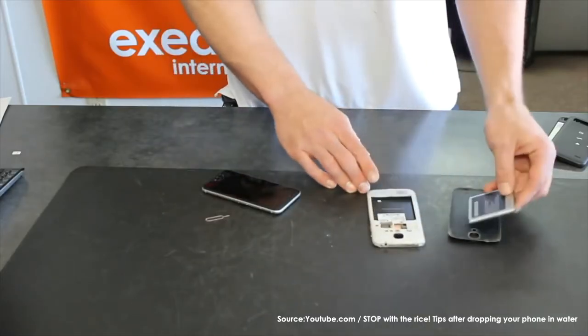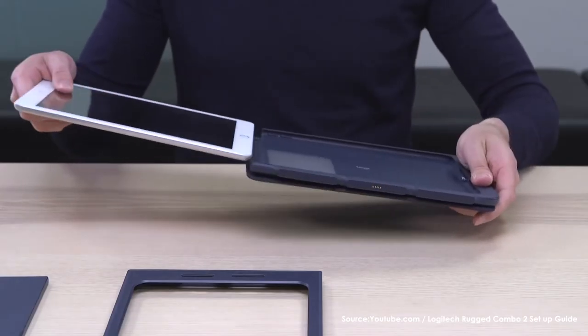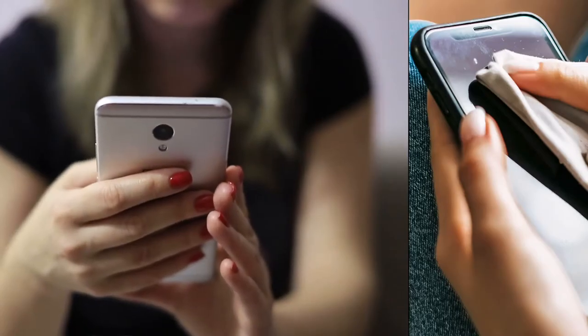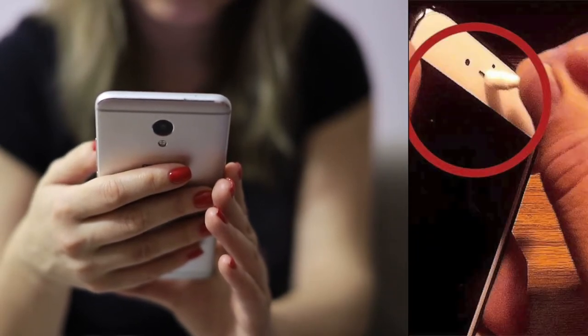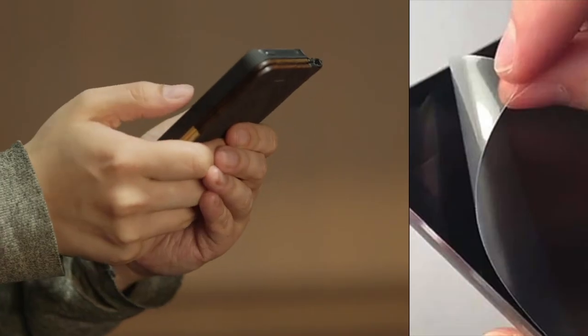Open up the device to get some air and let out some water in those areas. Also, take off the case to get rid of all trapped water, then shake it to get as much water out. With a towel, wipe your device thoroughly to get it dried out, then use some cotton swabs to clean the headphone jack, the charging ports, and the buttons so that water does not sit there.